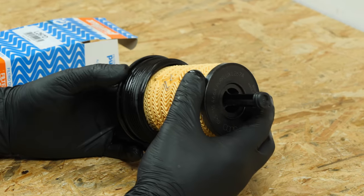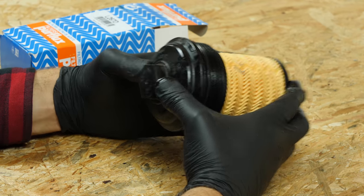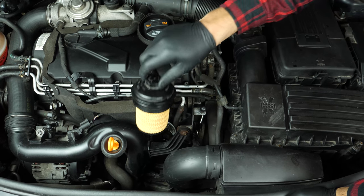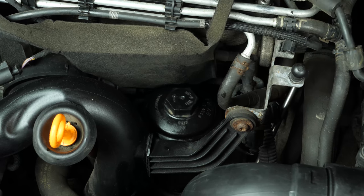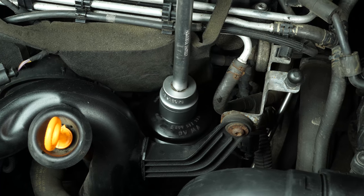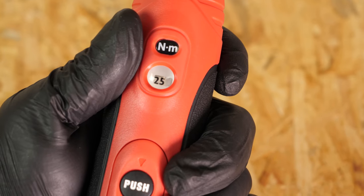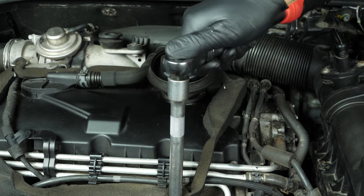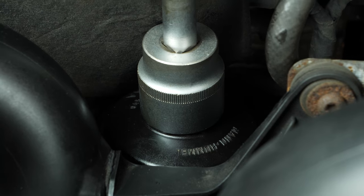Insert the new filter into the flange until you hear the click that confirms it has been locked into place. Re-screw the filter until it makes contact, then tighten using a socket wrench, an extender and a 32mm socket, adding a final quarter turn. Note: with this kind of oil filter, the new joint can be excessively thick, making the tightening process more complicated. Ensure that the flange washer is flat against the oil filter housing. You can also use a torque wrench set to 25Nm for this step.